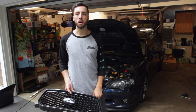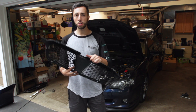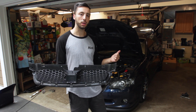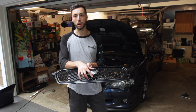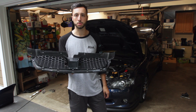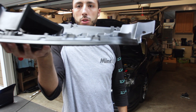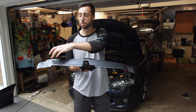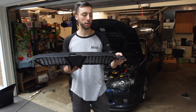The car is all situated — wheels are back on, car is sitting on the ground, bumper is all tightened up. The last thing is to get the grille installed. To get this grille to fit, it takes some slight modification given that they're from different generations of Legacies. The bumper is for an 05 through 07 US spec, and the grille is for an 08-09. This grille will work with the bumper with some slight modification: cut and file flat these little tabs here, then drill some additional holes on top to match up where the grille goes into the bumper.